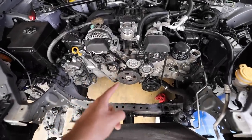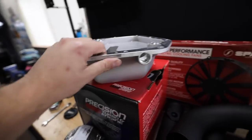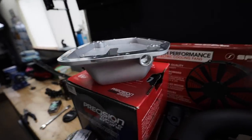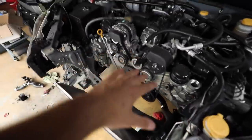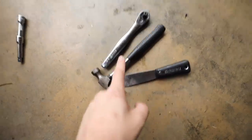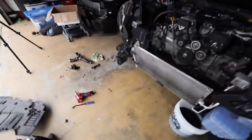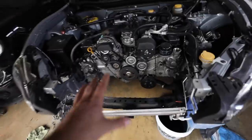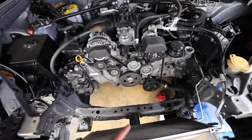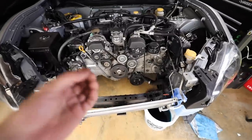The last thing that has to come off is the oil pan. Not looking forward to pulling an oil pan off — they're never fun — but we have to so we can get the full-blown Motorsports oil pan on with the turbo return port. It's just a couple of 10-millimeter bolts going around the outside. We're going to take my spatula, a hammer, and a ratchet, beat it in, break the seal loose, and pull off the old one. Once we get the old one off, we'll start installing the new stuff. The oil pan will go on first because I need to let that sealant cure before putting oil in the car.